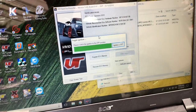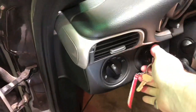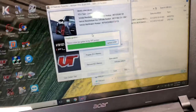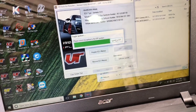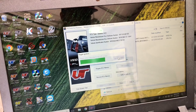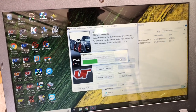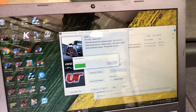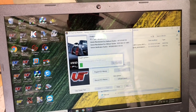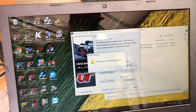Just finished programming, so now we do the switch ignition off. We click our little bar here — it counts down — and as soon as that's done we'll turn the ignition back to the on position and do the adaptations for the throttle body. It's required by any of the DFI cars, same thing the factory tool does when it programs.